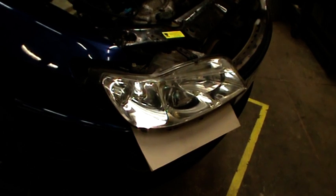As you can see, the headlight is now released. It's still electrically connected, and we'll look at the connections in a second. I just wanted to point out that as the headlight is now sitting forward, potentially resting on the painted bumper, I've just put a floor mat underneath the headlight to protect the paintwork while I remove the electrical connections on the back of the headlight.